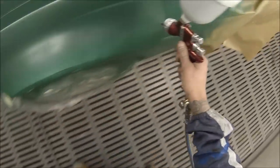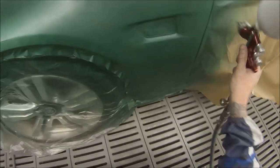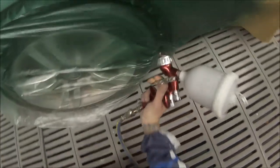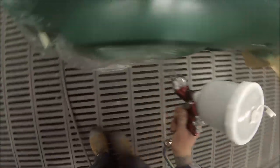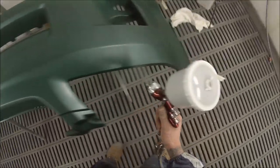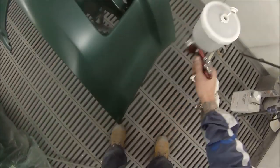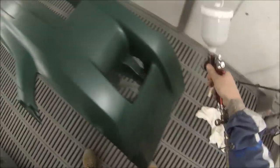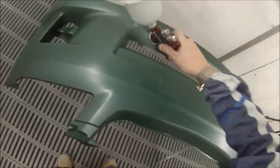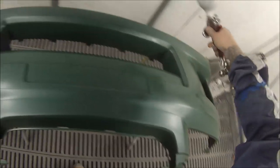You're just going to have to keep clearing, then grab a touch-up brush at the very end while the car is still hot from the bake. Put a bit of racing additive into your clear coat and dab them in straight away. If you leave them overnight, sometimes you'll have to sand because the paint's dried too much and it will actually pull out. You're better off doing it straight away as soon as it's in the booth — then it'll dry out and stick because the paint's still fresh.